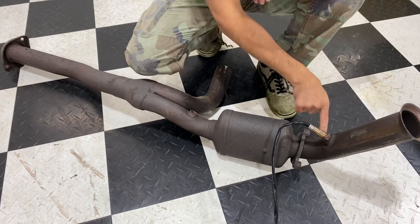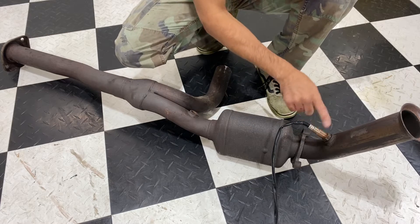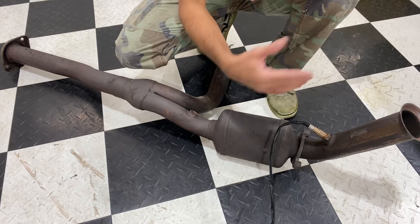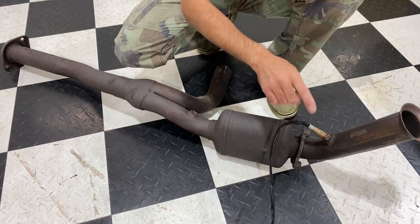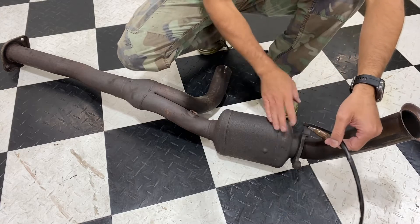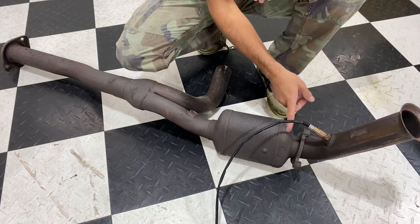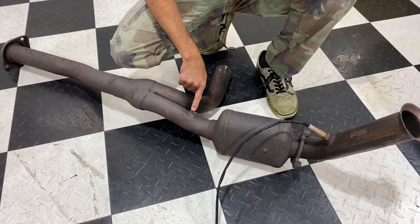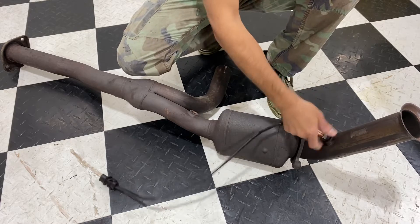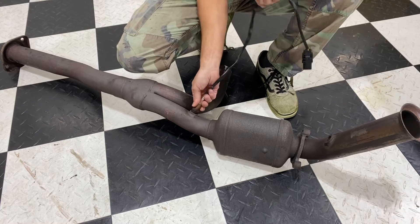This piece connected to the exhaust manifold coming off the engine, passes through the catalytic converter, and then out to the exhaust. This is your upstream O2 sensor — it comes before your catalytic converter, so it's known as bank one sensor one, or the upstream sensor. If you want to know more about oxygen sensors, I have links in the description.